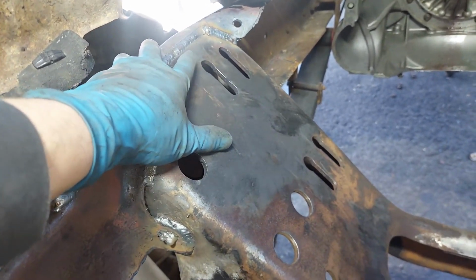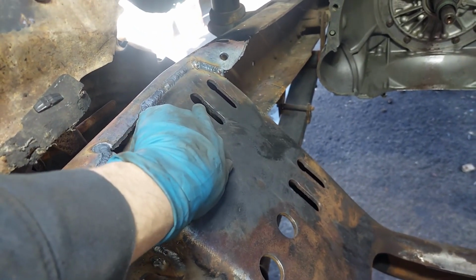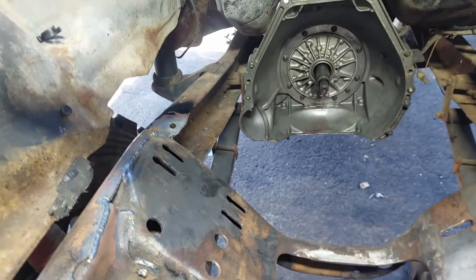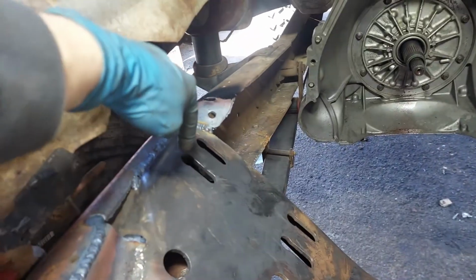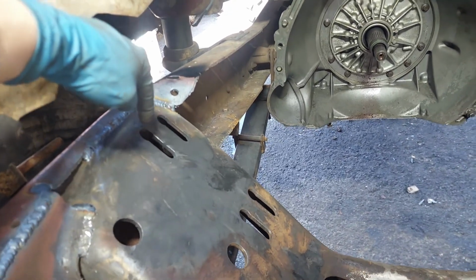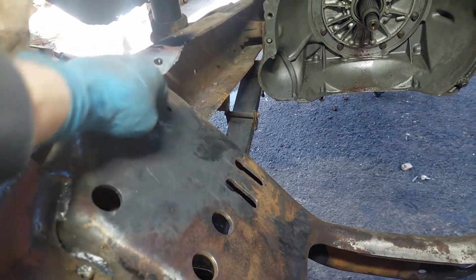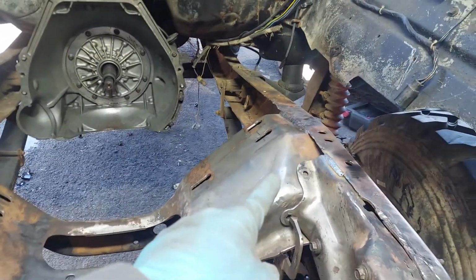And the motor mount is relatively big. The way the motor comes down, these holes are a little enlarged compared to the top. And that's so when the engine comes down straight, the bolts are almost vertical. So it's going to kind of come in here and then slide into position where it's finally going to rest. And that's the same from both sides.